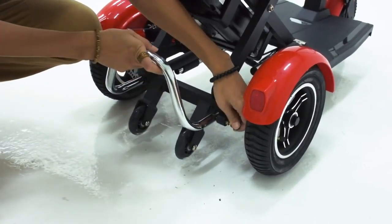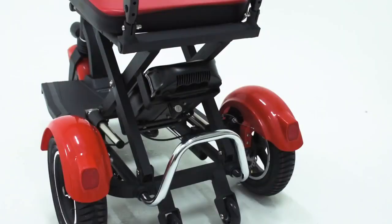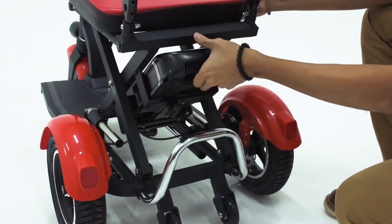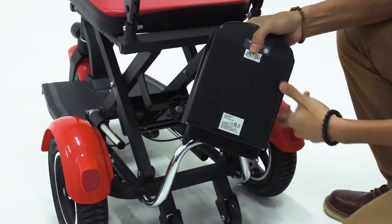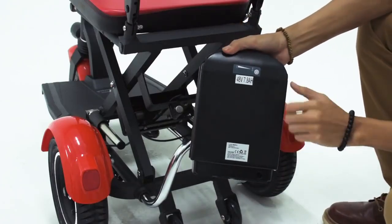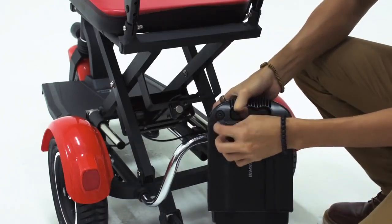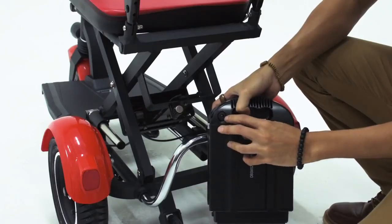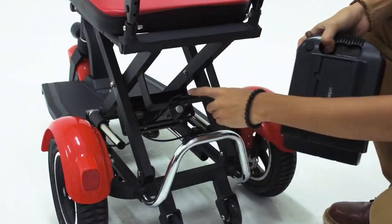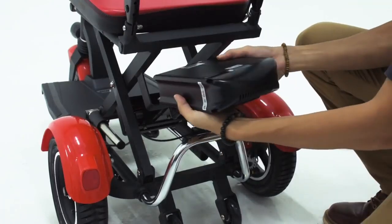Do remember to retract the rail when not in use. To remove the battery, use the key to unlock the latch. Pulling out the battery, you can check approximately how much power is left by pressing this button, which will display a colored indicator — green being full and red being near empty. The opposite side is where the charging socket is located. You can charge the battery while it's not attached to the scooter, which is pretty convenient. When reattaching the battery back to the Flexi, align the grooves of the battery to the battery compartment to secure it, then lock the latch using the key.